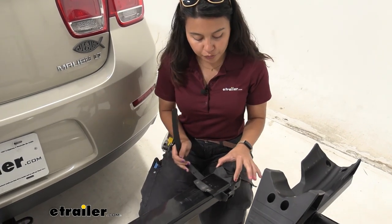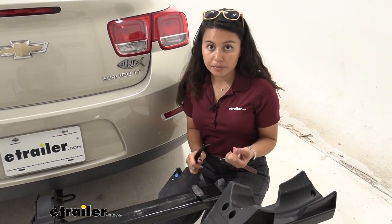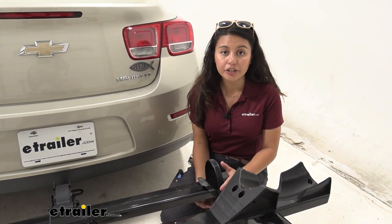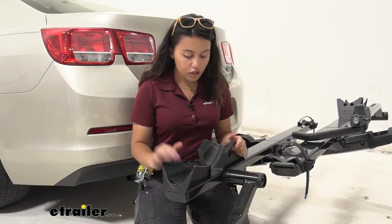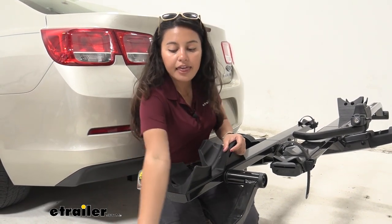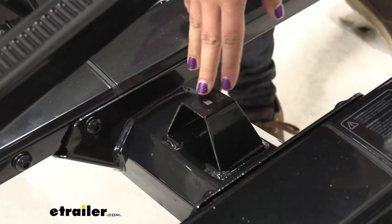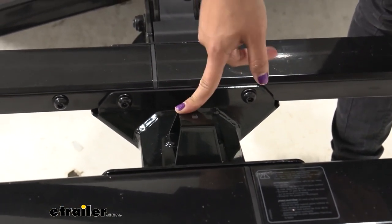With the bike off, let's take a closer look at the rack itself. The cradle slides back and forth for different wheelbases — maximum 52 inches. For tire width, the maximum on its own is up to 3.25 inch wide tires. For tires over 3 inches, I recommend looking at the fat bike strap adapter kit, which can carry widths up to 5 inches. You also have the front wheel cradle with grooves for different tire widths, and that hook I mentioned. The hook folds down neatly to the side. Underneath where the arm folds, there's a bracket for using your own cable locks.